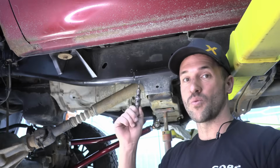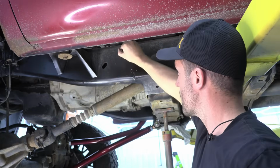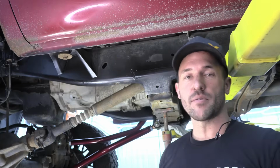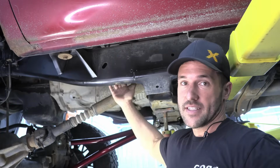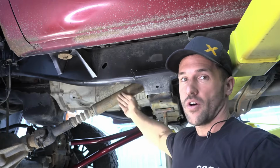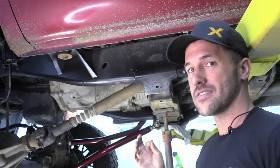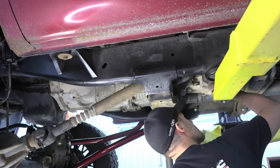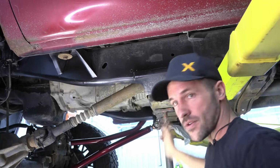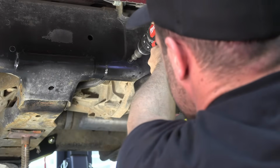We're gonna do all the holes with this on this side, or as many as we can reach. They're actually shorter, so you can get up here. For the through hole here, obviously we'll have to use a drill bit. And we got the drive line, so we'll actually probably be drilling both of these all the way through. But this back one is your hardest one again, because it's 3/8 inches of steel on both sides. And geez, we got the transmission on this side. We might be able to drill this one. It's been a minute. All right, let's start with this one.